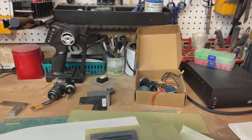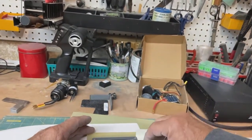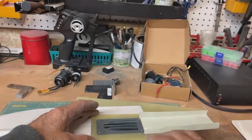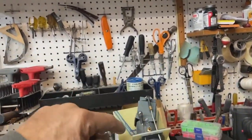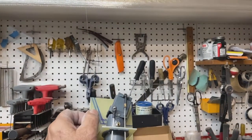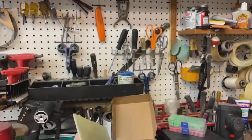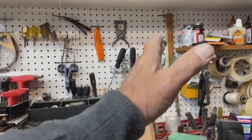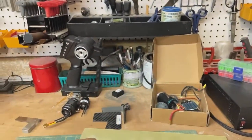On this base piece, once I decide where to trim it, I'll go ahead and trim it off. Where I trim this G10 could very well be a function of this or the slope of the hull — we'll see whichever controls the dimension on that. For the bucket to work, I'm going to have to cut out here. The sides are going to come in some, so there's only going to be about this much sticking out, leaving a little bit naked. Although I could extend just the verticals beyond here — that may be my solution — and then put a tapered edge on them to protect this.